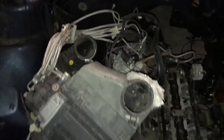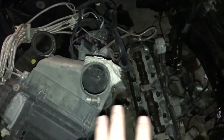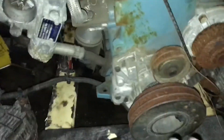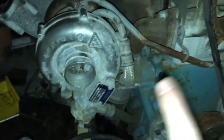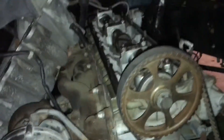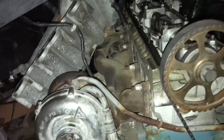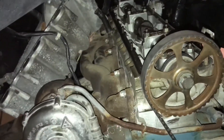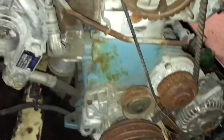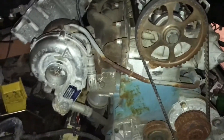Right now the plan is we're going to see about just getting this all hooked up. The motor doesn't turn over by hand, so we've got the intake manifold open and we're just going to spray some PB Blaster in there. We're going to see if we can't get this to loosen up. I'm going to let this sit overnight and come back to it in the morning and see if we can get the crank to turn by hand. Hopefully we can.